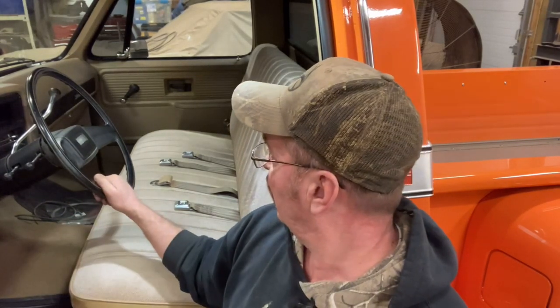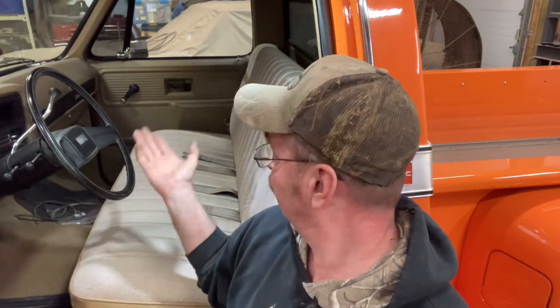Other than that, I think the interior's done. I did find the dome light switch on this side wasn't working. I traced all the wires just to find out it was just that ground switch. So I've got one coming — we'll get that in there, no big deal. But the inside, I can't think of anything else. I think the inside's all done.